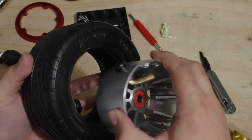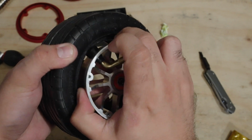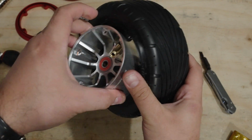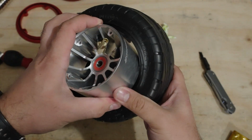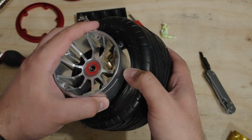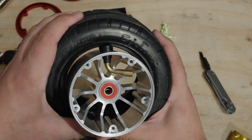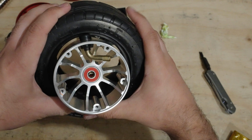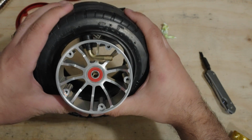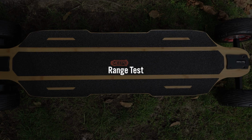Getting it back in, I actually like to put this grommet back in there, right on the face of the bead. If you try to put it in all the way, you're not going to have the same kind of engagement angle, and this is going to not form around there. So I just catch this right on the side. And once you've got it on the side there, it'll deform, and you can just push this past. So you squeeze it in there. See how it's deforming into the bead? And so you can just right there, and then it'll just pop right in.